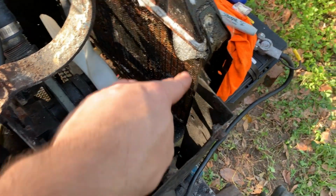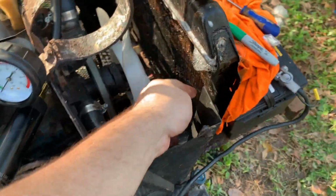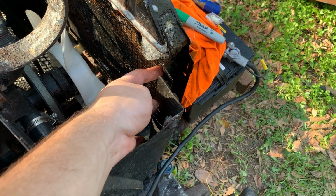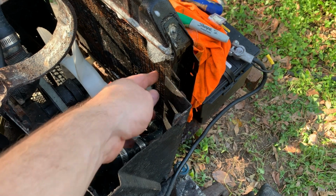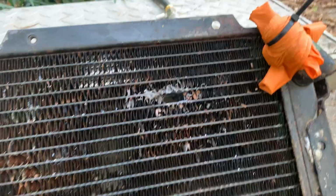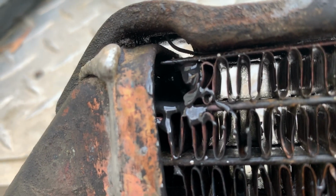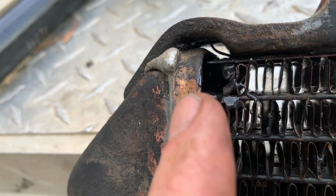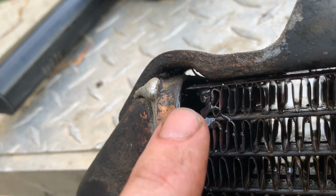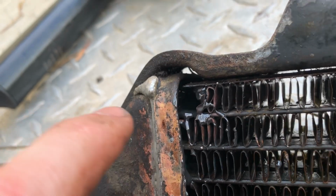and this upper part. I think I'm gonna have to cut out some of the, I don't remember what these are called, to get to the core, these cooling fins. All right, so I got these to seal up, and so we can pressure test it here. It's not perfectly sealed, but it's good enough. So I pulled away some of this stuff, pushed it down, got way up in there, and could see where it was leaking. It's this tube right here, but it's this side of it.